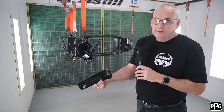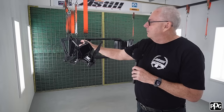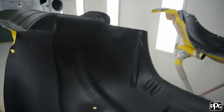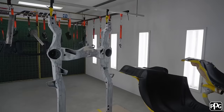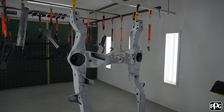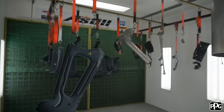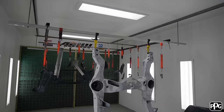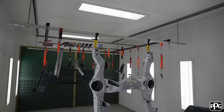If you've got brackets and things in a restoration, you can actually spray them like that. If there's something you want to rectify you can do it, give it a bit of a sand — otherwise they're ready to go wet-on-wet with your matte black or satin black. Back in the booth — I've got these all done with the stone guard. They'll now have the Delfleet primer and the satin black. The white on the chassis was the 4949 out of the Delfleet range without any tinter, used just as a bit of a filler. The Delfleet goes straight over bare metal. I expect to put wet-on-wet primer and then onto the satin black in the Delfleet.